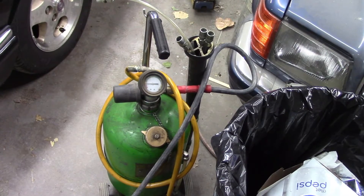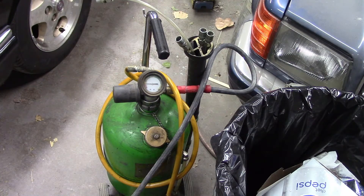So what I've got here is my vacuum extractor. I use this mostly for doing oil changes, especially if I have a car where the oil filter is accessible from the top of the engine bay without having to get underneath it. Then there's no reason to lift the car up, get underneath it and drain the oil — you can pretty much siphon the oil out and change the filter from the top. Pretty much any of my Mercedes built in the late 90s — the 129s, 210s, 220s — they all have oil filters accessible from the top.